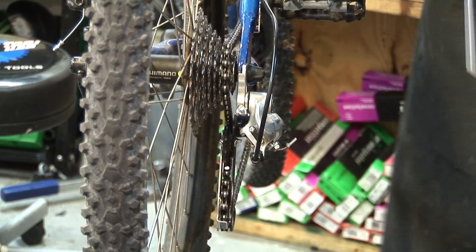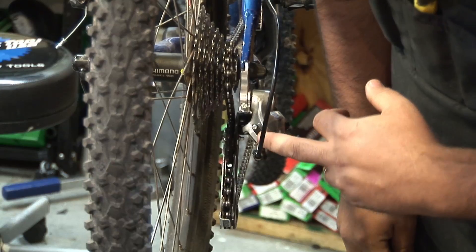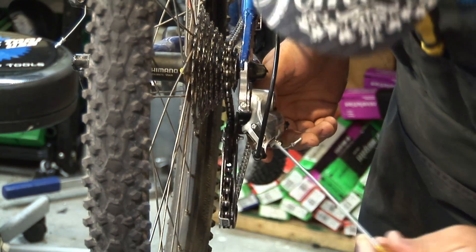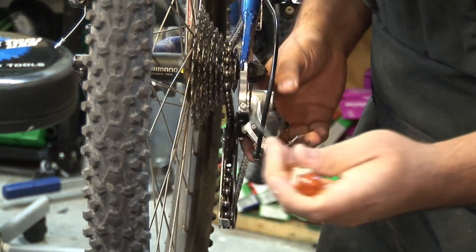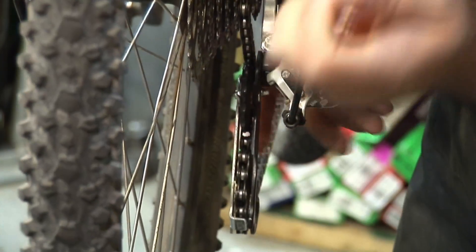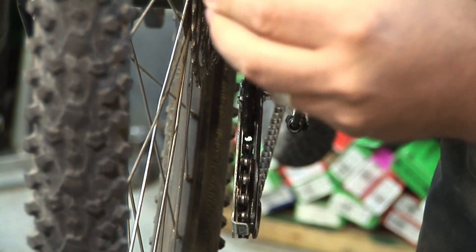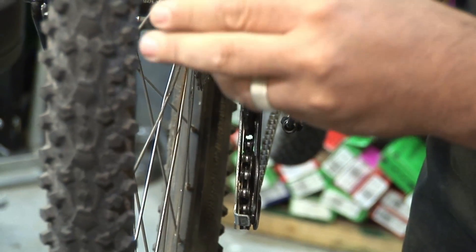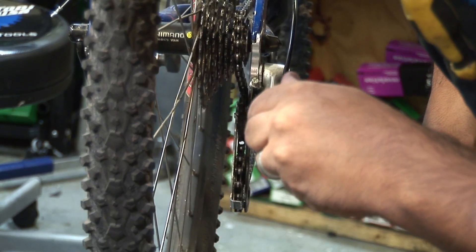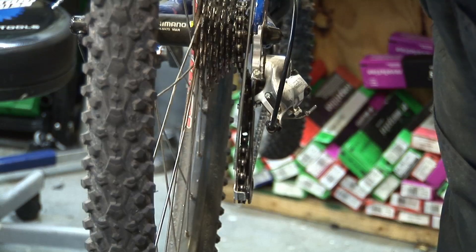As you can see, we're off. So I'm going to come to the screw that has the association letter H — that's my high limit. I want you to watch this rear derailleur and see when it is lined up with the lower cog. I'm going to turn this in. As you can see, the rear derailleur is moving — and right there, I am set up with the lower cog.